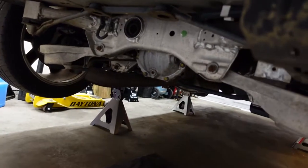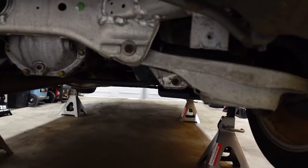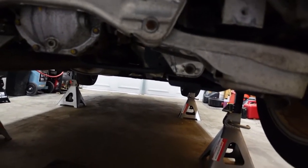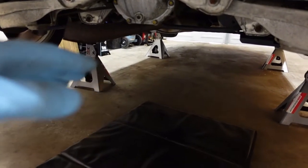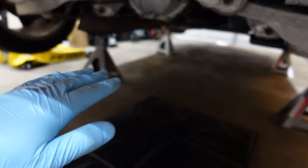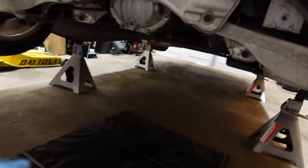The first thing to do is get your vehicle on jack stands. I decided to jack up the whole vehicle on all four jack stands, not just the rear. My thought is that the subframe is heavy with everything connected to it — if the car is angled forward, the subframe might shift forward when dropped and cause difficulty lining things up. If it's level on four jack stands, when we lower the rear subframe it should come straight down and go right back up.